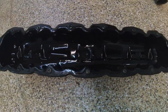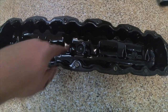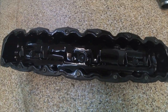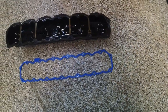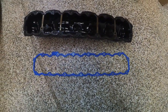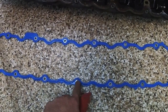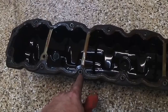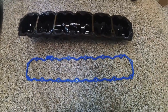Here's the old valve cover. As you can see, the oil fill port right here in the center, accessible via oil cap, and then it's got these little grooves all along the edge where gases would go up and around or oil would run down and over. I've got an old gasket versus new gasket comparison here — they've got their differences. The new style has seals that go around the bolts; the old ones did not, but these also had grommets. Just a change in design over the years.